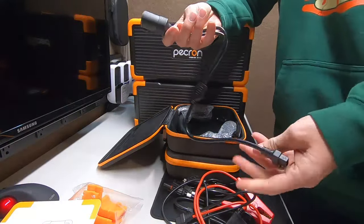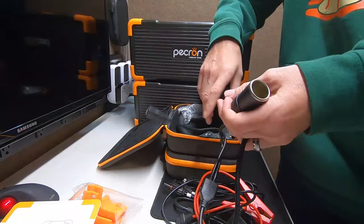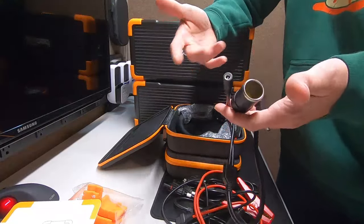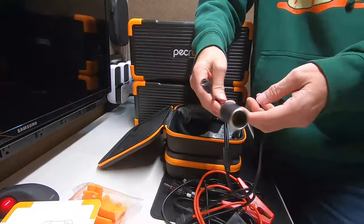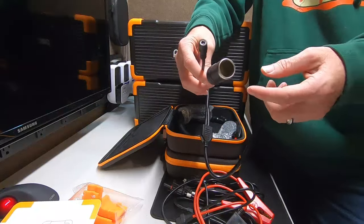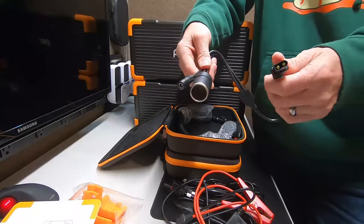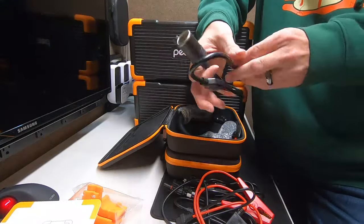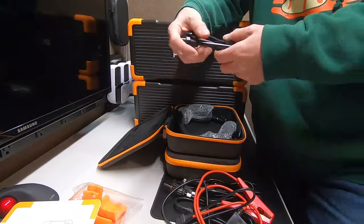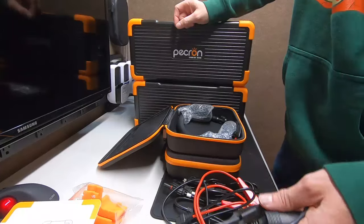So you basically plug this in your system, you turn on your inverter, and then you can use this with anything you want, whether it's ham radio, CB, like we don't use them, but whatever you guys would use them for. You can put a crock pot, coffee maker in there, or basically whatever you want that's 12 volt. But remember, it's 12 volt up to 30 amps, guys. That's a huge amount of power that can come out of there. That's a big amperage. Once you get past 15, you can feel that heat come through those wires.